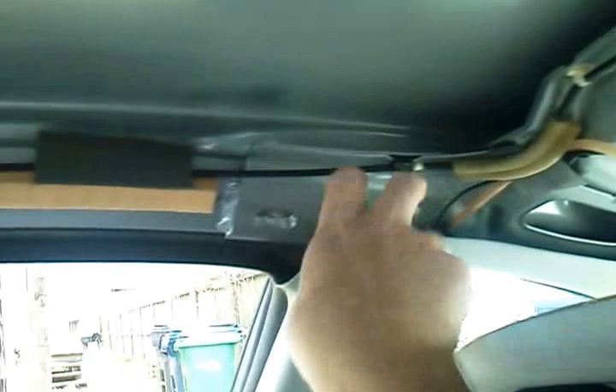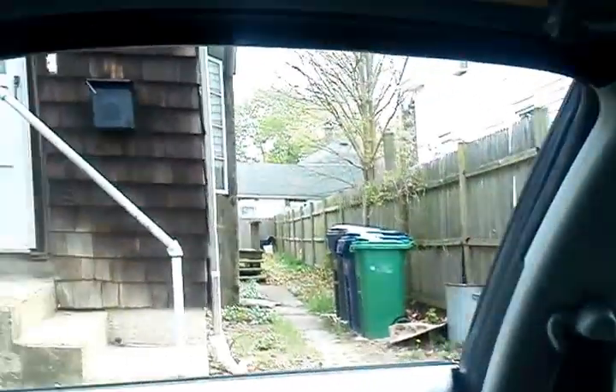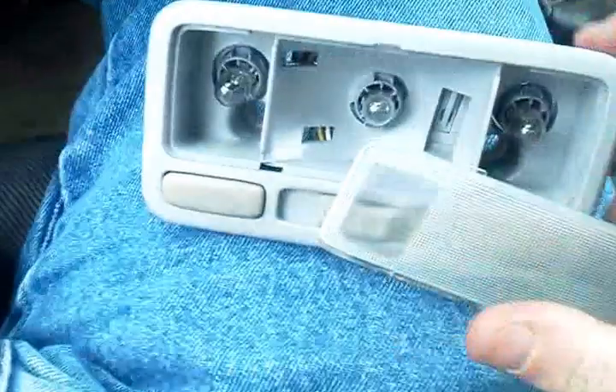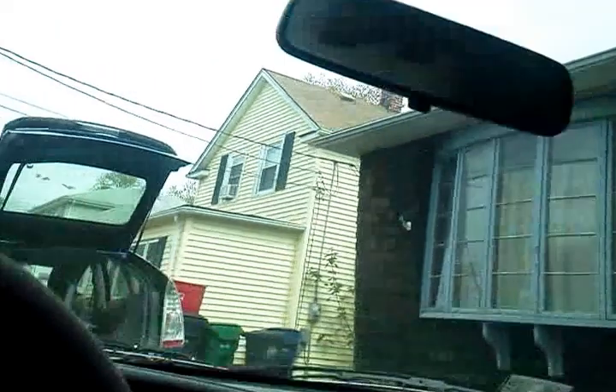There are like two or three little clips on top that get pulled back — you don't have to take them off, just take off that top tension. The lens comes off the lights, and then you've got these two little bolts, which you can see there. So that takes that off, and that is one of the things that helps hold the roof panel in from the inside.